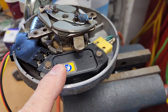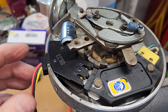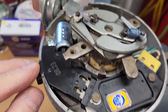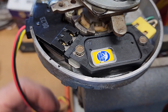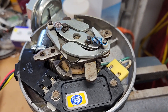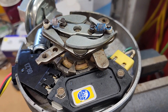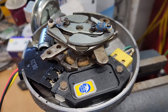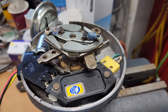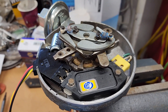We have the module now mounted in the distributor, plugged in, with a little dielectric grease on the terminals. It's a really nice little unit — fits right into the distributor, nests into the little opening on the side, and there's the little screw holding the capacitor down. This distributor is still in good shape. I put a little money into it — when it's done I might have 80, 100 bucks into repairing it. It's not an everyday driver, so this should give me quite a few years of service.